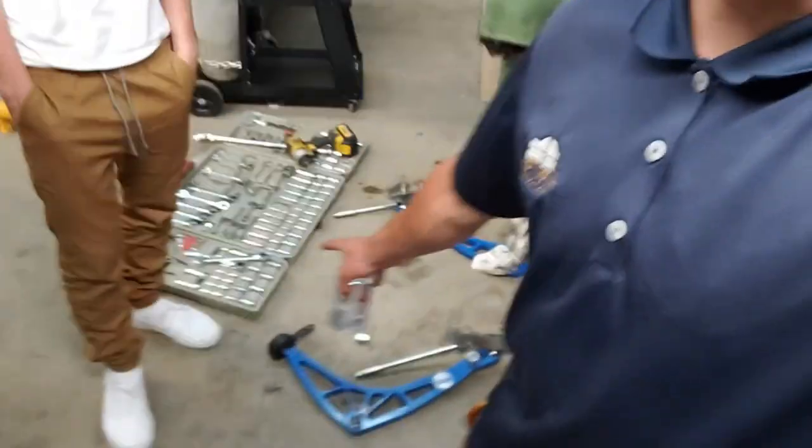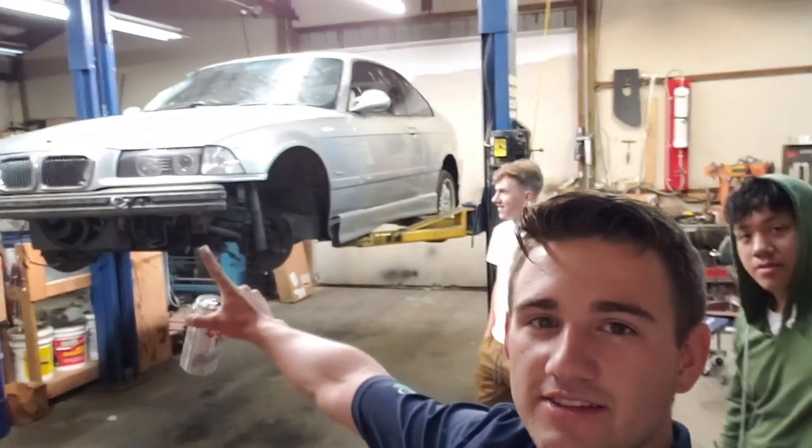The guy wasn't the most helpful, but we got the kit. It's a lot of money but still a good deal — much better than buying a new kit. The only problem is it doesn't have the adjustable f-cabs, which let you adjust caster so you don't hit your chassis at full lock. So we're gonna have to limit full lock for now until we get those adjustable f-cabs. Let's throw this angle kit on that ugly thrash car and send it.